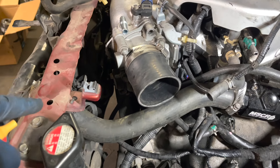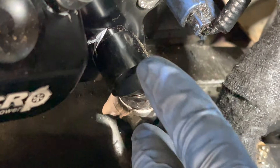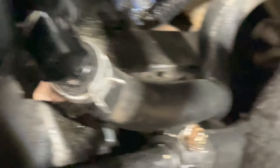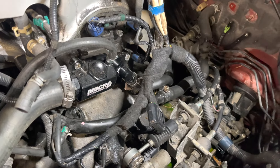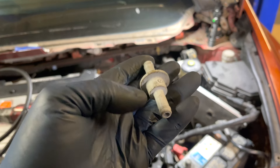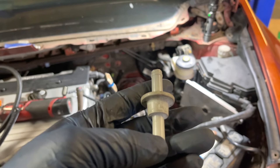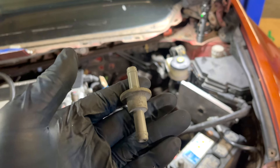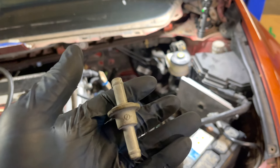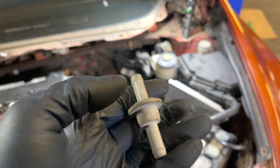Water neck is installed. I cleaned up some of the wiring and taped it up - I'll heat wrap it with reflective silver or gold tape. You don't really have to do anything with the heater core lines because the downpipe clears all of that and doesn't get that hot. I also rerouted the ECU wires underneath the shift cables - those will get heat wrapped too. You will need to change the upper water line; you can get a bendy hose from an auto parts store or one of the K-Tune style lines for swap cars that goes down and under.